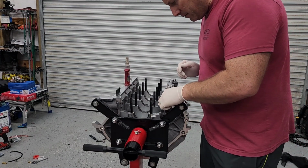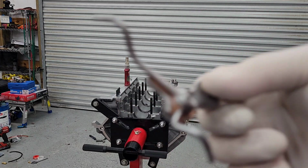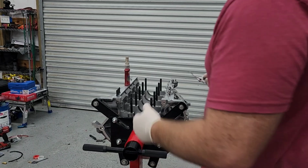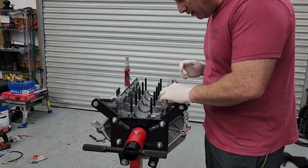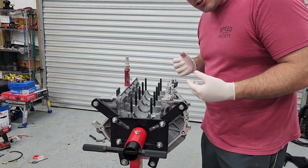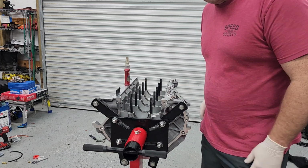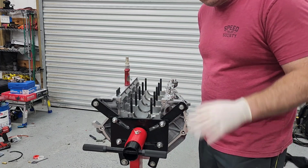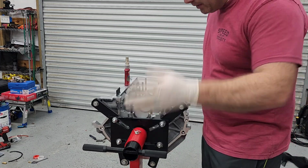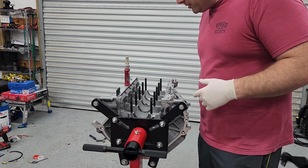So I almost forgot, before I got too far, I am going to use oil squirters on my build. I did buy block offs, but this will be a street driven car, not basically an all-out drag car. So I want the additional benefits of lubricating the walls and stuff, since this will be driven a lot more than just trailering it to a drag strip, making a pass and shutting it down. So it's up to you, of course.